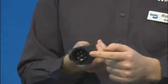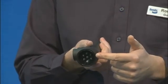In order to interface that normally on a trailer, you'd go to the front of the trailer where you have your glad hands connecting and the trailer power. Most of you are probably familiar with that connector right here — that's the standard 7-pin power connector on a trailer. You would pull off the main line on the trailer and insert this T-piece.